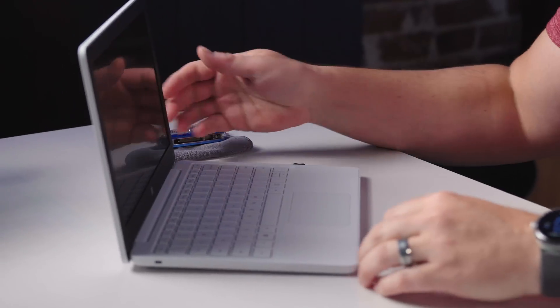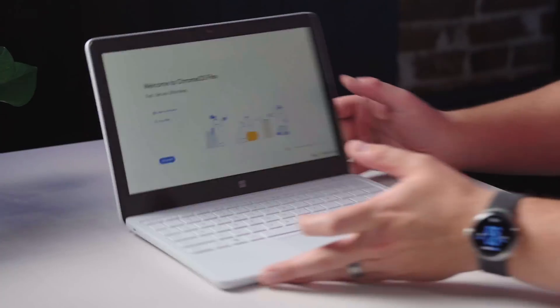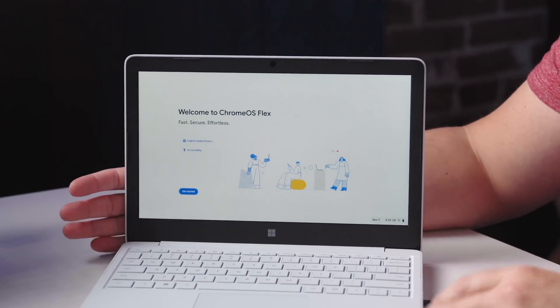However, we are here. We are ready to get this thing up and running, and I have not tested any of this stuff yet. We're going to do this right from scratch because we're going to trust that green check mark from Google. Without any further ado, we're going to take our USB disc image, place it in the USB port, and go ahead and power this thing on. What should happen is you get a Windows boot screen with a big red bar across the top saying it's not secure — that's just part of turning off secure boot. Unfortunately you're going to see that every time you boot. But immediately after that, you'll see Chrome OS Flex load up the way it's supposed to, and boom — just like that, we have Chrome OS Flex up and running on here.